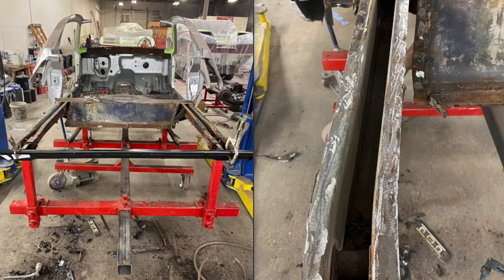At this point I decided to go ahead and get the rear frame rails cleaned up. The back trunk drop-offs weren't that expensive and they had a little bit of rust, so I removed those to get inside the frame rails and clean them up real good. Got the back frame all stripped down to metal, self-etched primer put back on. The back cross member was kind of rusty and had a little bit of damage — it was probably under a hundred dollars — might as well just replace it with new.